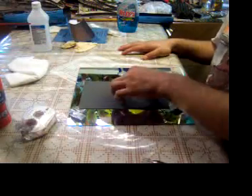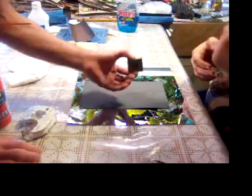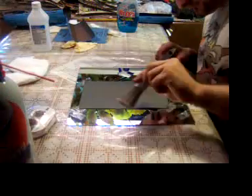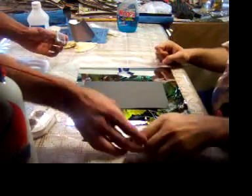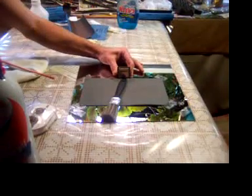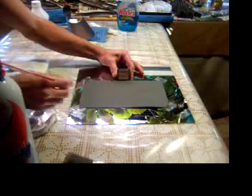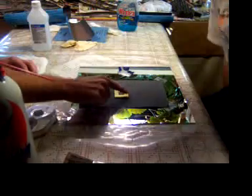Pull it up and look at it — get a nice even polish. Grab your paintbrush, dust it off, dust off the back side, and dust off your piece of sandpaper. You can see with the paintbrush now we're really starting to make it shine. Make sure it's coming down — wow, yes! Now we're starting to get a mirror out of the job here. We're going to continue — two fingers on top of the CPU, just on the pads.